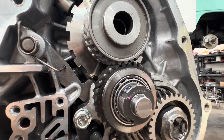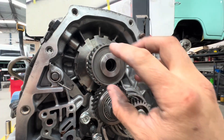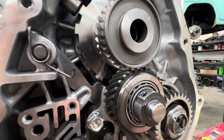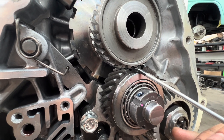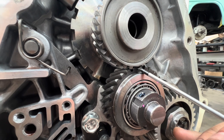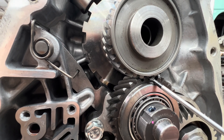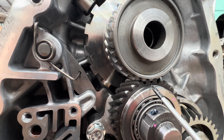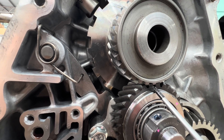I'll just pause and take a quick close-up video to show you what I meant. When the top gear is turned clockwise, this tooth here butts up hard against this tooth here in the transfer gear — they meet right where the screwdriver is, pushed hard against each other — which then, turning clockwise, creates a gap at the back side of the transfer gear tooth.